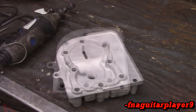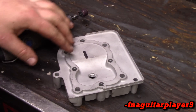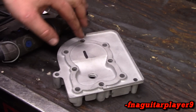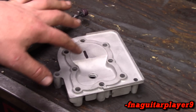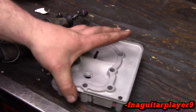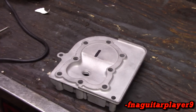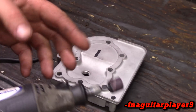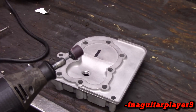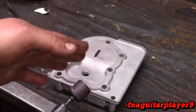Don't forget your safety glasses doing any type of metal work like this. You want to make sure it's dipped — you don't want just a square channel. Some people cut it in a milling machine and leave a sharp edge, and that can cause a hot spot, which can cause pre-detonation — like knocking. I'm just going to do a very mild one on this because I don't want to do nothing crazy and ruin this head or lose too much compression. I'm using a dremel with 120 grit paper, and I also have 60 grit in case this doesn't cut well enough. You want to make sure it's good and smooth when you're done.